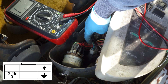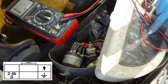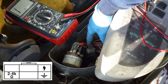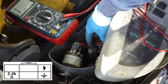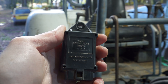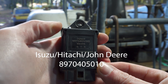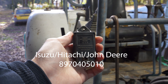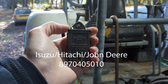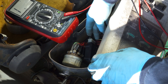So with all these inputs considered, this module should be working and activating the glow plugs. There's another wire for the indicator light but that's not a concern. I'm going to go ahead and swap this timer module out and recheck to see if the glow plugs work. Here is the part number for the timer module — I'll also link it in the description. It was about $12.